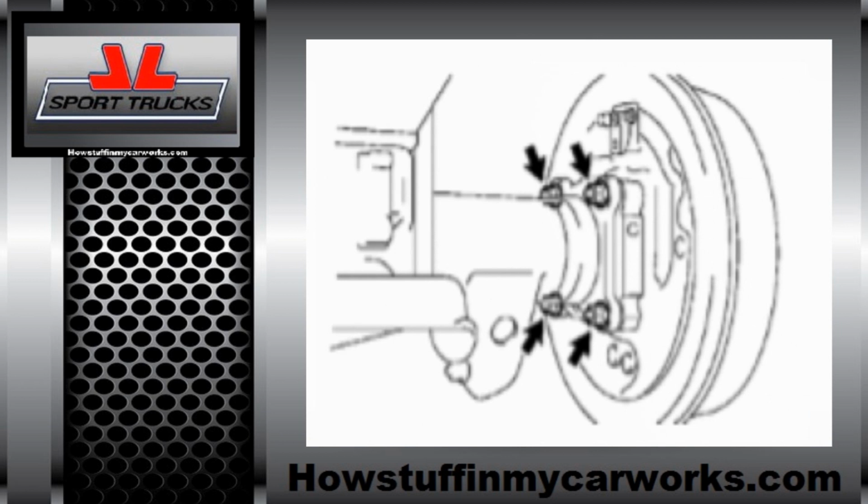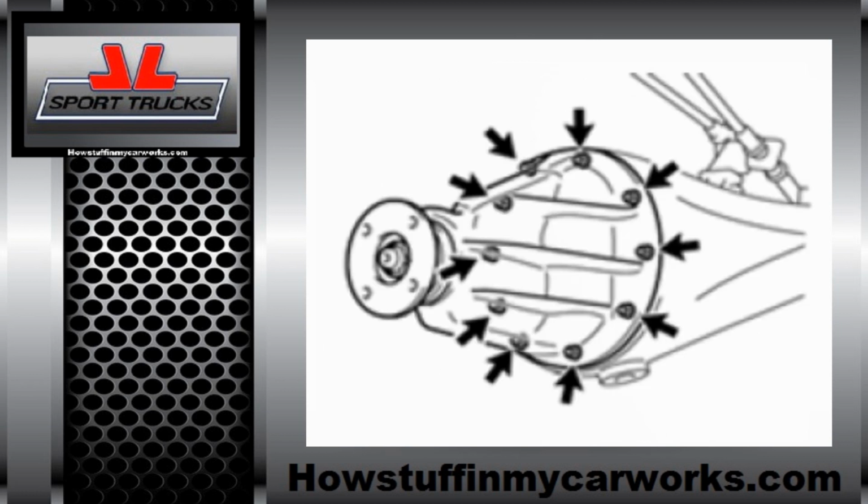Remove the 4 nuts from the bearing retainer and pull the shaft and backing plate from the differential and set it aside. And of course you need to do this on both sides. Remove 9 of the 10 nuts and washers that fasten the differential carrier to the axle housing and leave the last one finger tight.